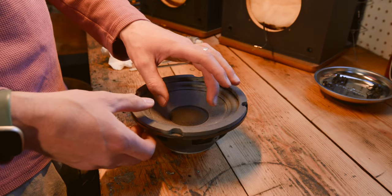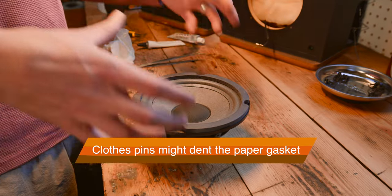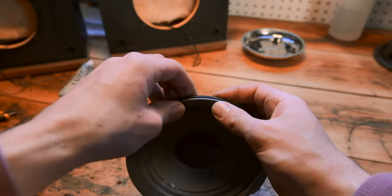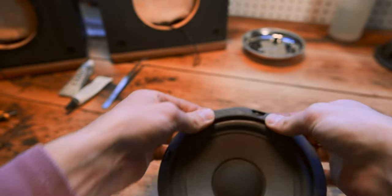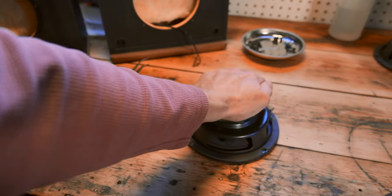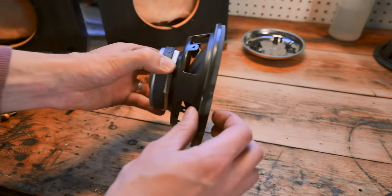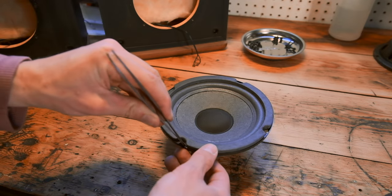Now that we've kind of applied some pressure, check the voice coil — no rubbing. You can get clothespins or something else to clamp this down if you want, or in this case we're just going to go ahead and actually flip it upside down. Before you actually just set this down, you want to really vice grip it with your fingers before you just flip it over and let that kind of take care of the sealing. You want to just make sure you apply a nice even pressure, even if that's just cupping your hands around it in a couple of different spots, because it does lift up a little bit. Push it down for a little bit into the table, apply a lot of pressure onto it, especially just make sure you have it on a flat surface. The glue is still tacky in there — you can see it goes up and down and you just want to make sure that that does not happen. And then you can also kind of tamp down the foam in the screw holes just to make sure that they're nice and sealed all the way around the hole with glue.